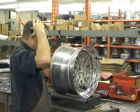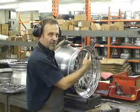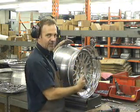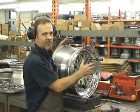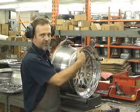When I tighten the nuts, I usually tighten one and then go 180 degrees, tighten the other one, then come back 90 degrees and go across from there in a crossing pattern. After I get 4 of them tight, then I just go around the perimeter and tighten them in a row.